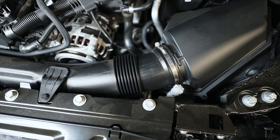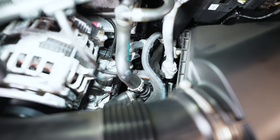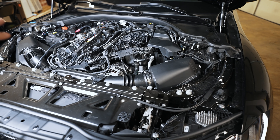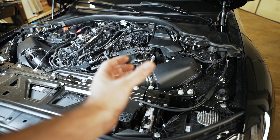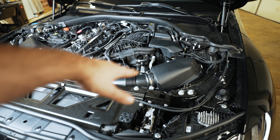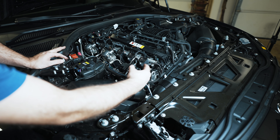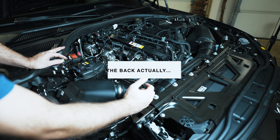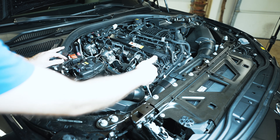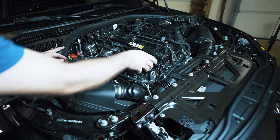You have your coils, injectors, two fuel pumps, oxygen sensor connectors, high and low pressure sensors, MAP sensors, T-MAP, coolant reservoir for the charge air cooler, and the eccentric shaft motor for Valvetronic. There's not a lot that differs from older engines — technically there's less going on given there's no mass airflow sensor. I got pushback when I claimed emissions is making these cars more reliable, but from a quality and tolerance standpoint I believe so. That's a redundant throttle body in case your Valvetronic acts up — the compressed air from the turbos joins together and comes up into the bottom of that throttle body, which is open under normal circumstances, then goes into the charge air cooler. You have your Vanos solenoids to control variable valve timing up near the front, and your crank sensor telling the DME the crankshaft position.